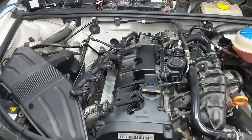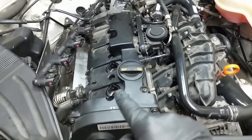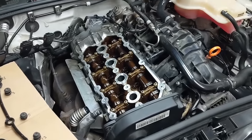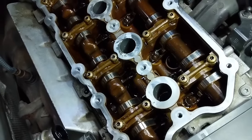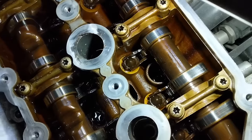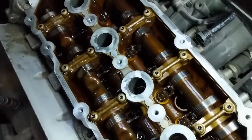To be really thorough in our testing we need to look inside the engine a bit. Since we have the ignition system detached, all we need to do is remove a few things from the PCV system, the breather hose, a couple of bolts on the front timing cover, and the bolts along the valve cover itself. The valve cover is off — I was really careful to stay organized on the way out. Other than junk I knocked in while taking off the cover, things look as clean as I was hoping for. There's some oil staining but it's really consistent, and looking down into the head there aren't any irregular deposits of darkened oil spots.